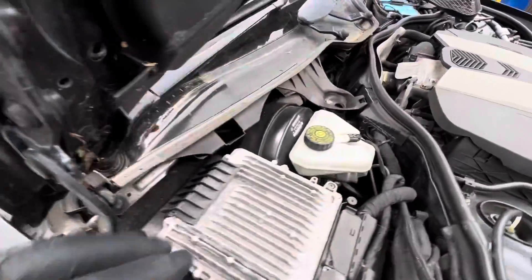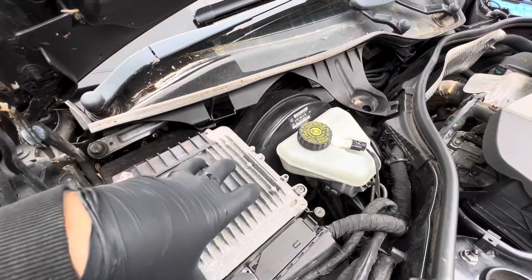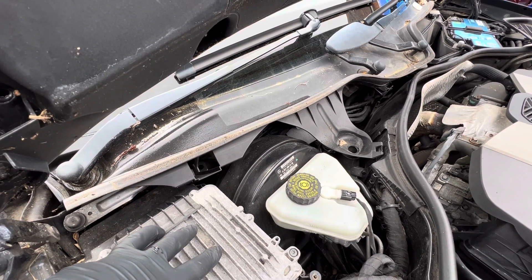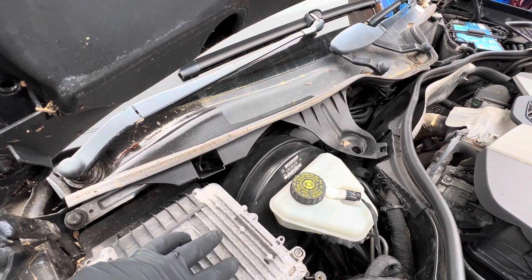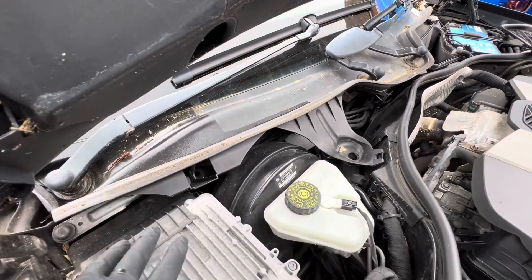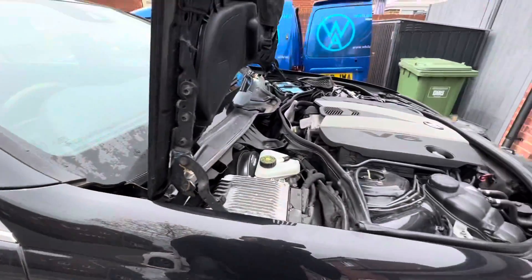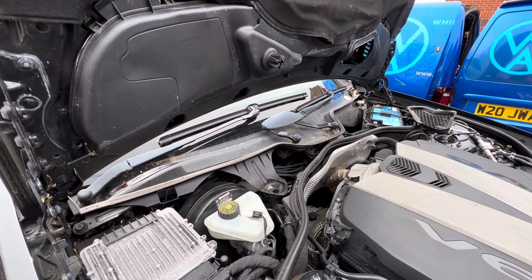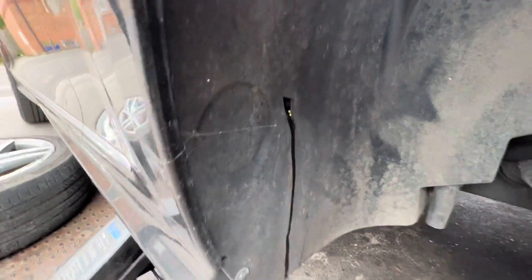The water is backing up inside the drain tube and then pouring up and over into underneath here — where you've got your brake booster, engine control unit, fuse box — and it's all sitting in here. Then it finds its way through the weakest points, because while everything's sealed, some seals aren't meant to be submerged. They might be a foam seal — splash proof but not submergible proof — so this filling up like a bucket means water seeps through. We're going to clean all these drains out. As you can see it's slowly draining now, but yeah we'll clean these out and show you the result once finished.